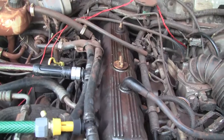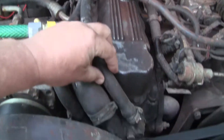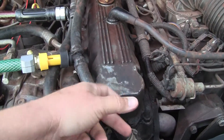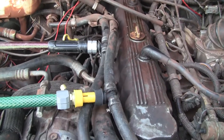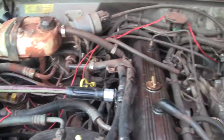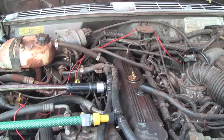Because this rust will stain a driveway literally forever — it's powerful stuff. What I learned to do, because I watch the other end of the hose and watch its dirty output, is take some pliers and squeeze the hose so it doesn't let any water flow one way, only the other. You do that for like 60 seconds on and 60 seconds off and it purges the daylights out of the heater core, then out it goes.